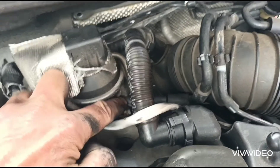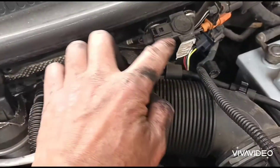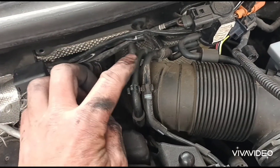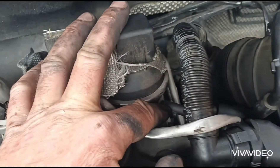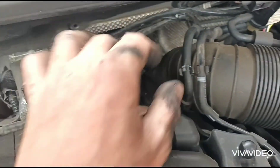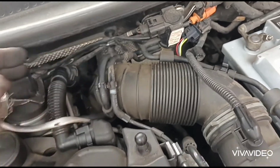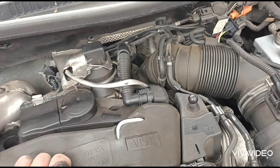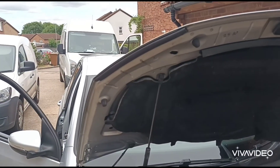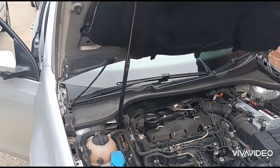You can see when I disconnected this end, that hose is holding pressure — it's pulling vacuum from this side. But when you disconnect it from the diaphragm end, it's not holding. We know the hose is holding pressure, so if you connect straight onto the diaphragm there's a slight chance there might be a split in the hose that you wouldn't notice. That way we've checked the hose and the actuator at the same time. This video is just for diagnostics — we're all about done and hopefully we'll get this swapped over in another video. See you next time.